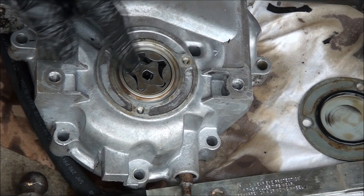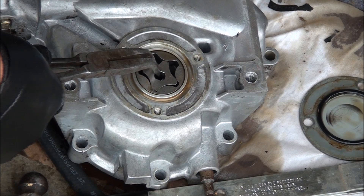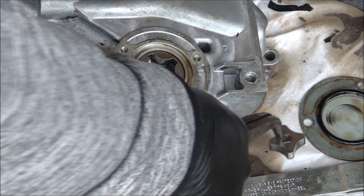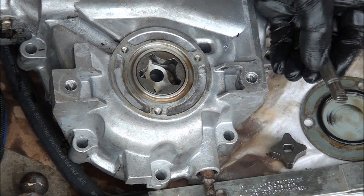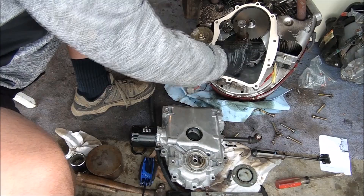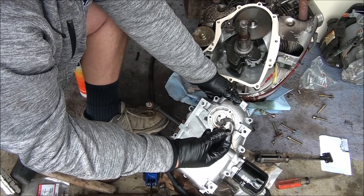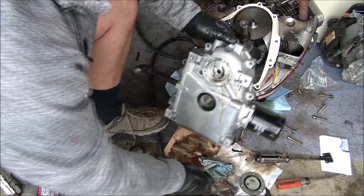Remember we took the shaft out from underneath — I'm going to go ahead and take this piece out and set it aside. The shaft — you can see the shaft goes in like this. Lube up this shaft really good so the oil seal slides on without damaging it putting it on. You can take this little piece out too — it doesn't matter which way it goes in. And don't forget your dowel pins — that's important.